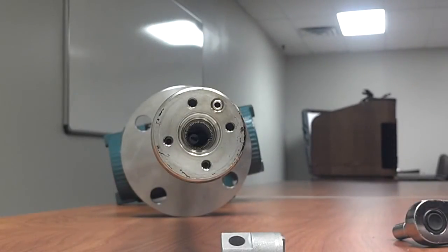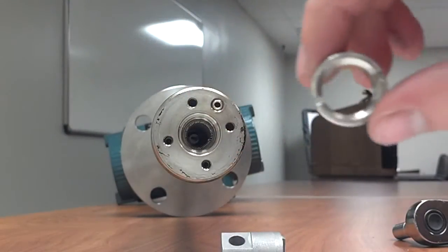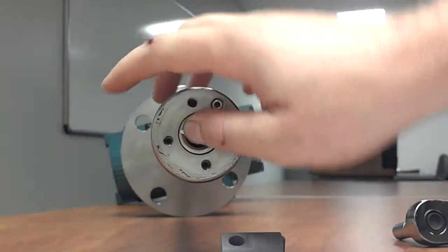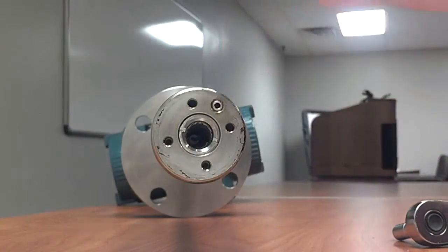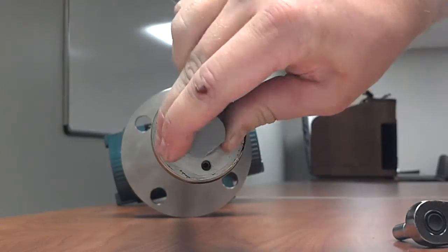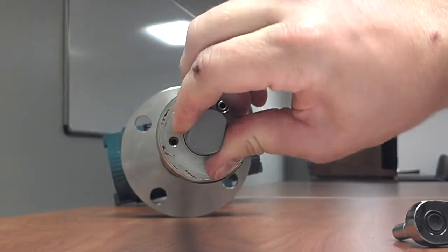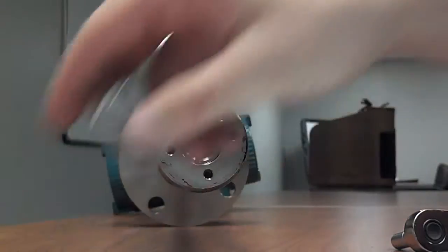Now you're going to grab this nut and put it back in — this is right after the contactor spring step. Make sure to put a little anti-seize around these threads so it doesn't get locked in next time you try to replace the cell. Go ahead and finger-tighten it, then use the K9470BX tool to screw it in. Once it's good and snug, give it a quarter to half turn with the screwdriver.